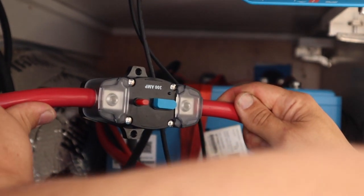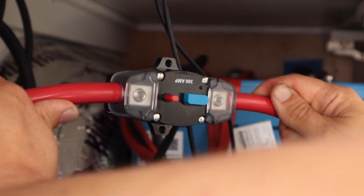We had a little trouble getting the system started up — it ended up being the breaker. A piece of advice if you're installing an alternator like this: use the absolute highest quality breaker you can find, and make sure it has large enough terminals. Breakers even up to 300 amps often have very small terminals, and that was our issue. After switching to the new breaker, it has not popped at all, and during road testing we got it up to almost 200 amps of output.